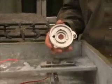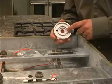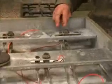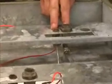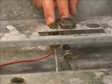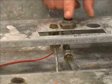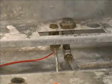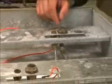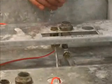When you're wanting to simmer, here's what the competition does: in simmer, they simply send a smaller amount of flame through the main burner area. However, on DCS, how they've done such a tremendous job is they actually have 2 different ports where gas comes out, and you have 2 individual feed lines that support each one of these ports. As you adjust your control valve from high to low, it manipulates how much gas they send here, but when you go to simmer, no gas comes out of this port, and it all comes out of this smaller tube right here, feeding that ring that we looked at earlier. It's an awesome idea. It allows you to achieve those low simmering temperatures, and ultimately we were really excited because we wanted to show you this broken down look to see how all this stuff works.